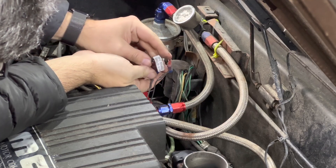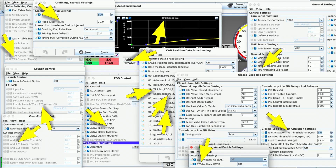Here's the thing about throttle position sensors — they're nice to have because they give the ECU a hint about what you as the driver are actually doing, but they're also optional. Stock DeLoreans don't even have one. Since mine wasn't working anyway, I just disabled it by shorting the sense pin to ground, meaning it should be reading zero all the time. It's been that way for a couple of years and it's been working fine. But the sensor isn't reading as disabled anymore — it's showing seemingly random values. These were usually small, between zero and two or three percent, but once when I was debugging it, it spiked up to 50 percent.